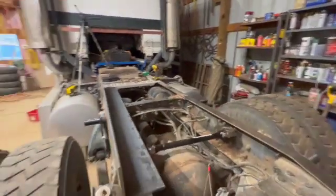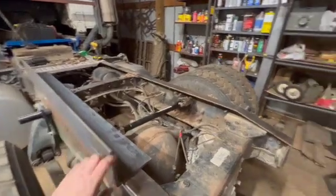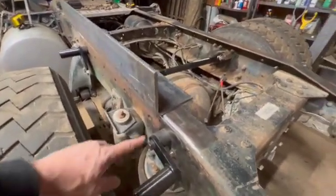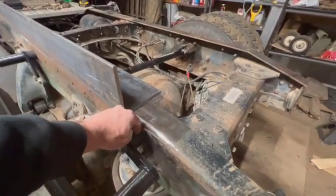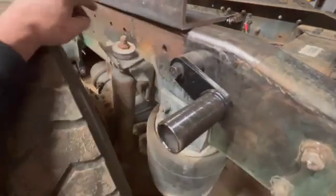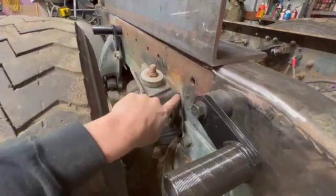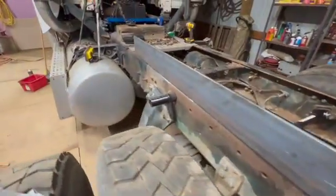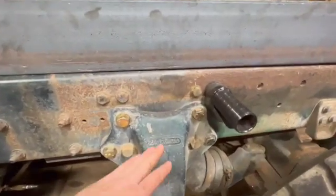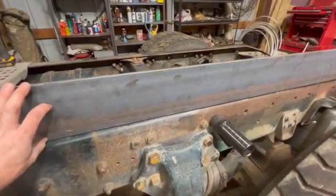So what I have determined is for this to sit in there, for this to sit, it's going to come this way, and of course, and then down. So this is 6 inches now. We need to make it 4 inches so it can clear this bracket and the top of the loose spring bracket right here. So we're going to take and cut this down to 4 inches.